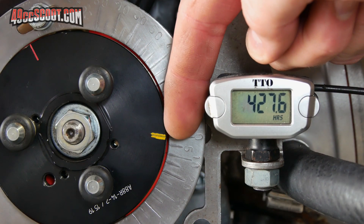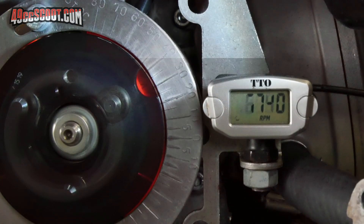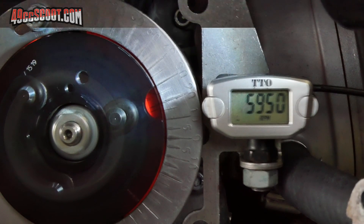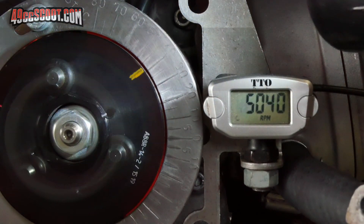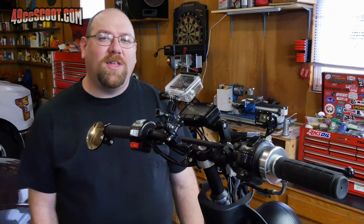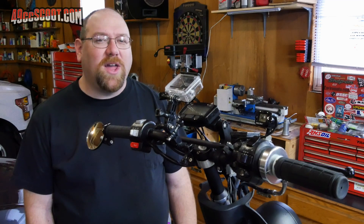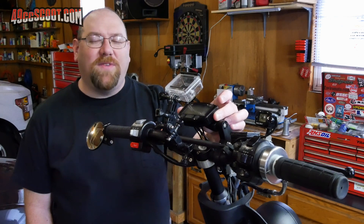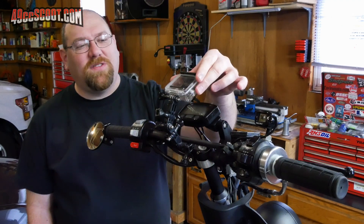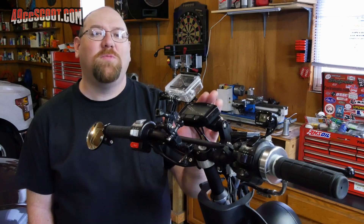Now it's all set up so that this yellow pointer is zeroed directly on top dead center. I thought that was going to work until just over 10,000 RPM, and then the gauge took a sudden jump backwards — that small tach just doesn't want to read up there, could be a signal issue. My Trailtech Vapor, the gauge I normally have mounted to my scooter, seems to have no trouble reading RPM up there, so I've set up a GoPro to watch that. I can sync that with the other video looking at the timing indicator, and then we should be able to see what's going on.